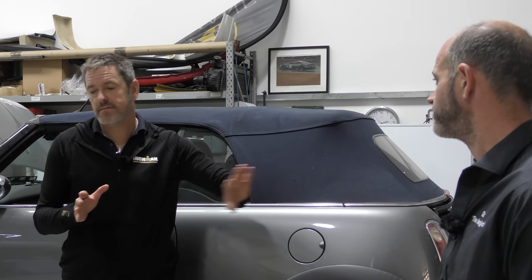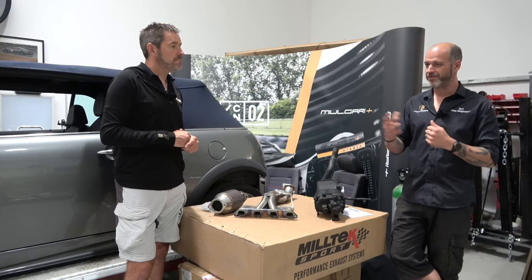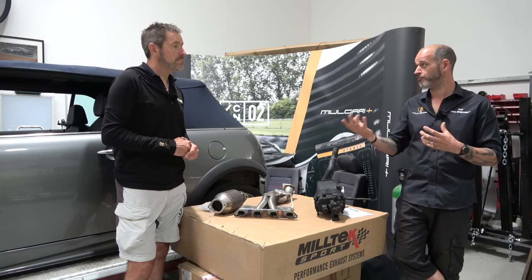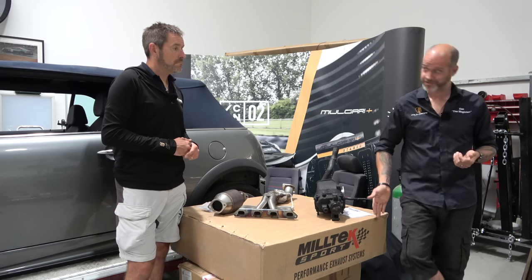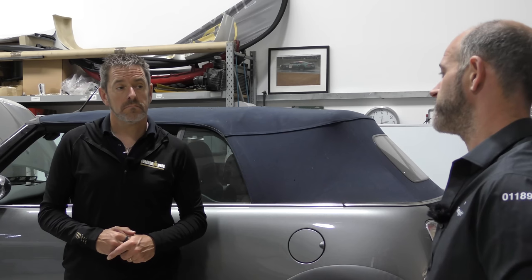Yes. And then some manufacturers will still get the hump because you're changing the exhaust. But there are some that understand the network of pipes from the OPF to the back of the car that change the tone or the note or what have you. Don't really find much performance there, but it's more about, you take the M cars that I do an awful lot of, and the modern day M cars, the most common complaint I have is it doesn't sound like an M car anymore. Even with the M performance system on there, they're quite muted. So there are a big number of aftermarket manufacturers, these guys included, who have solutions to that. Sometimes it's just straight pipe work all the way to the back of the car. Sometimes there's some magic going on in there that actually amplifies the sound back closer to what you'd have seen in an earlier pre-OPF car.